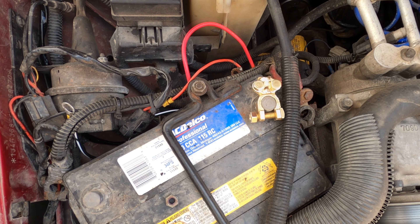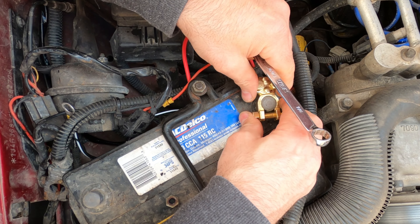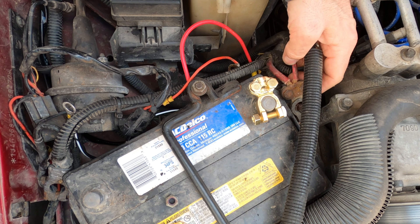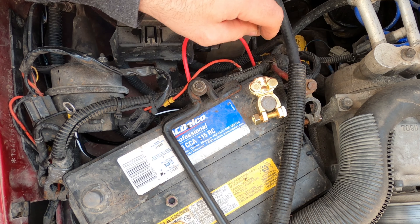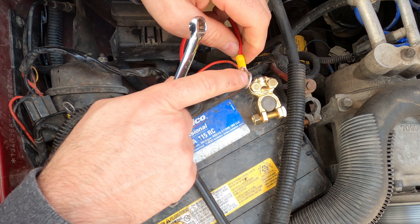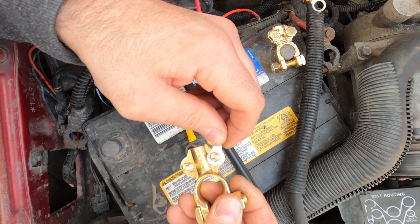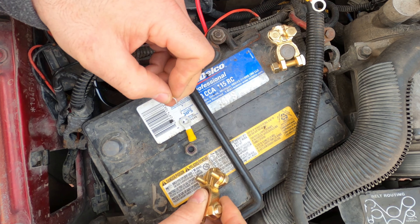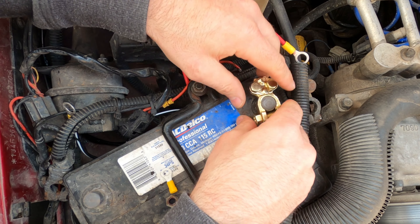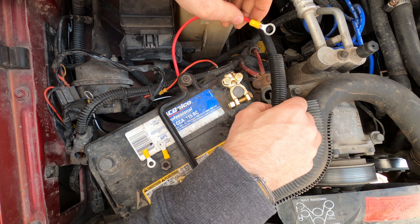Taking out the whole bolt — this terminal now fits on the post, which is great. I'm going to loosen the wires off the old one, move them over, and also put this wire under one of the posts. It would have been nice if it was a little bit smaller. I'll check the garage to see if I've got some smaller ones. I found some that are going to be just the right size, so I'll remove the ones I currently have on both the positive and negative, get them ready, and after that start moving the other cables over.